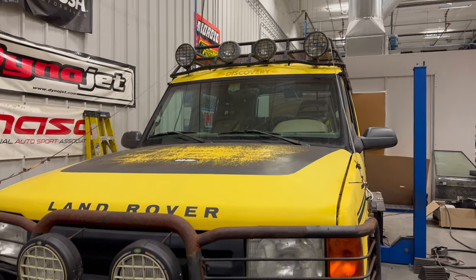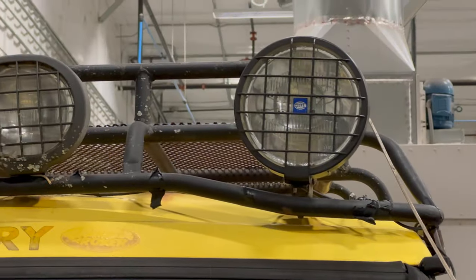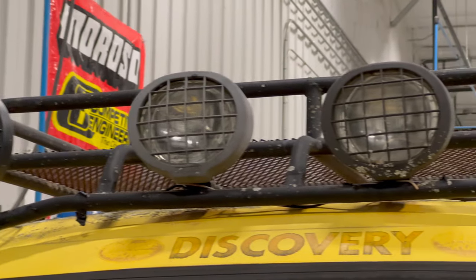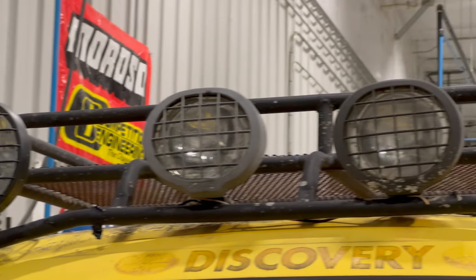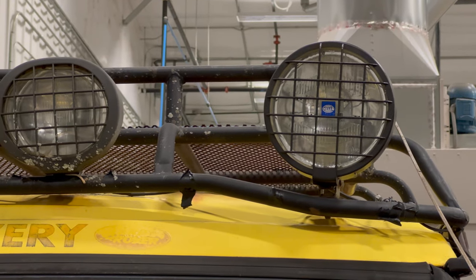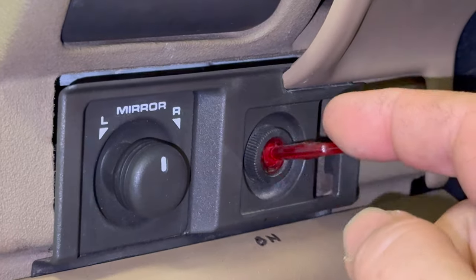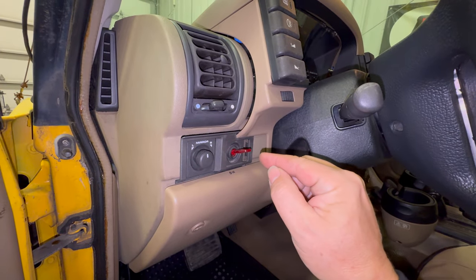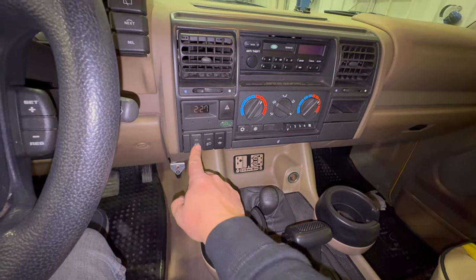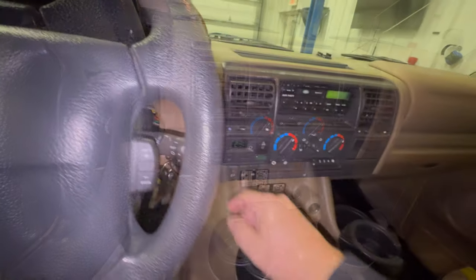On this vehicle, we have three types of lights in two different locations. I'm going to call these the Land Rover fog lights — the grill lights or the fog lights. Then on the roof rack we have a Hella on each side, and these other two lights here, I'm not sure what brand they are. As far as I know, all of these roof lights would turn on with the same switch, but I might be wrong because I've never seen them work. Inside the vehicle there's a switch right here, and I can hear the relay click when that's on — it is still clicking with the key off. So whatever this switch is triggering, it can be on when the key is not on. Then here in the center console there's a couple of switches which I assume one of these should turn on those lights on the grill.